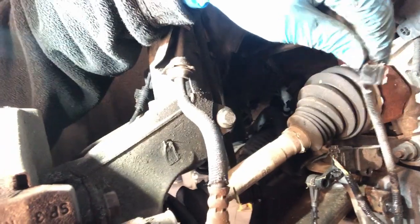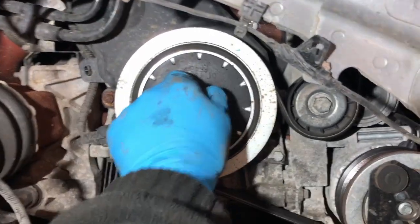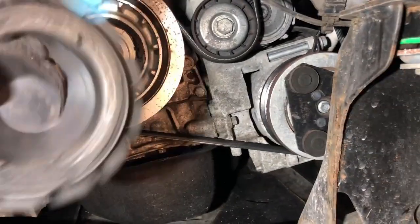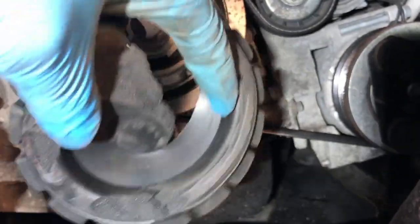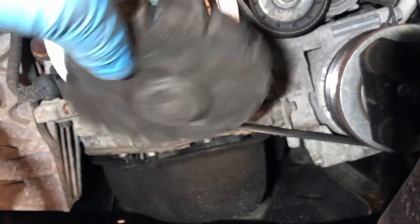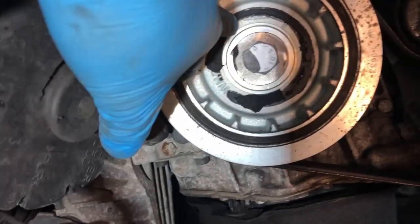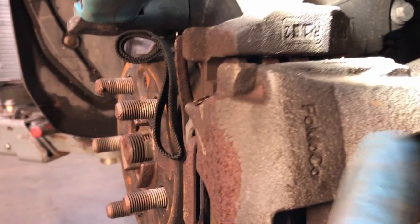Make sure you unclip that cable as well. Here we've got the crankshaft pulley. Behind there you've got the nut. I had a go at getting this cover off and it's stuck - it's actually glued to the crankshaft pulley, so I've torn it getting it off. I'll just glue it back together with some silicone. Interestingly it has 'Ford' stamped on it - Ford on a Range Rover.